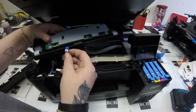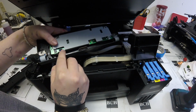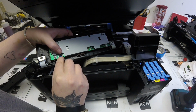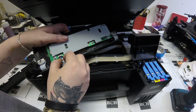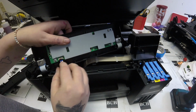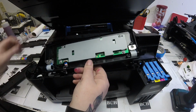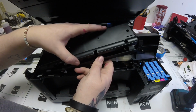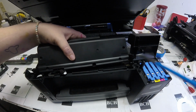Here I was just trying to make sure that I had it fitted in correctly. So pull that black piece up and fit your cable in with the pins facing the correct way, and then just snap that black piece down on top of it for it to hold in place. After we get that done, we can go ahead and basically just put it back together. Now that was the quickest, easiest thing to do. So now we have our back plate again, putting that back on. And we'll put the 4 screws back in it.